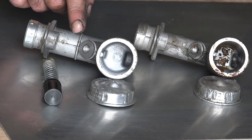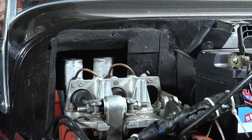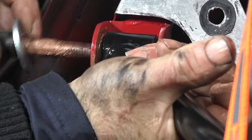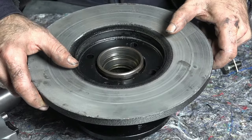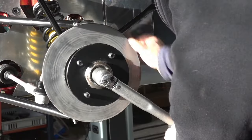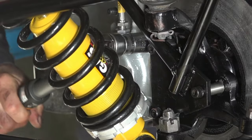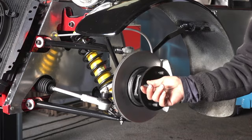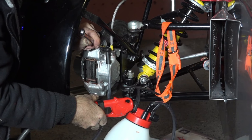The master brake cylinders and the clutch cylinder were not much better — they also had a lot of corrosion. We cleaned them all up and refilled everything with DOT 4 braking fluid. Then it was time to reassemble the wishbones, the shock absorbers and the wheel hubs together with the brakes. Here I'm installing a new bearing and setting it to the right tension, which is important. The brake calipers go back on together with the brake pads, and you can see the run-out on the disc is very low.